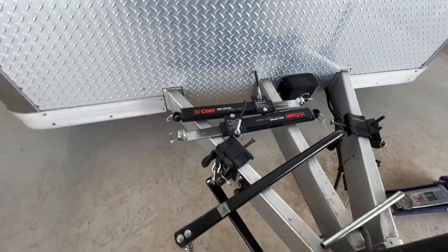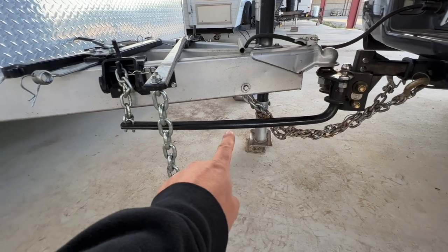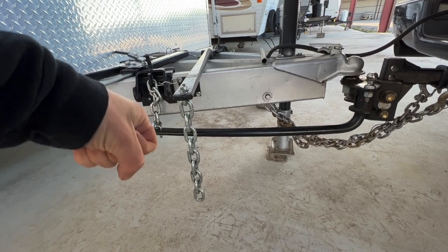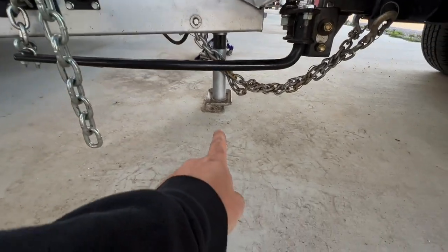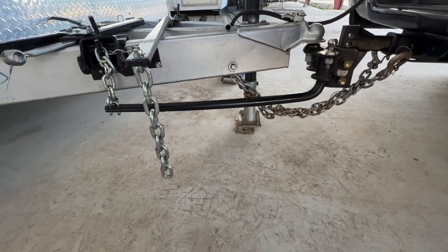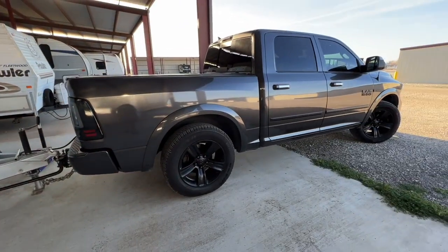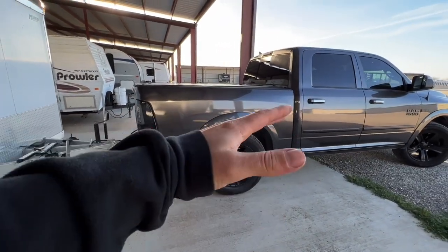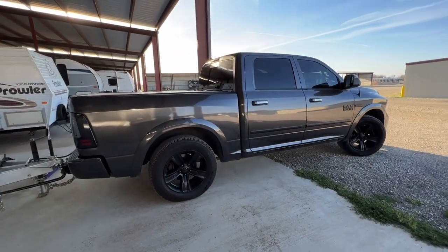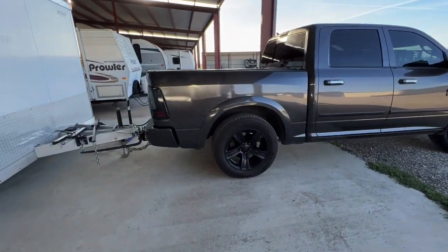Here are the bars — you can see the chain on the other side, and this is how it looks installed. It comes out and has tension under it from the chain, picking up on the back of the truck. The trailer is fully loaded right now, the jack post is off the ground, and it's looking pretty decent — I haven't even added air to the bags yet. You don't want the truck squatting in the back; it's pretty much level. This is factory suspension — trucks come with a little bit of rake.